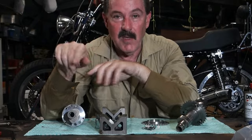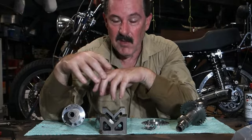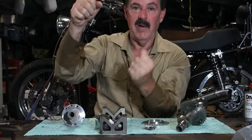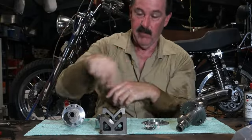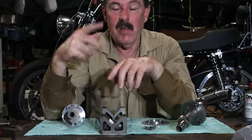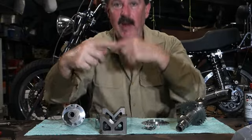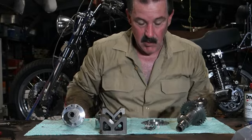And there are other times in its rotation where you're probably compressing 3 valve springs all at one time. So in other words, as you're turning the motor over, it's sometimes quite easy, and then you'll get to a very, very difficult part and you've got to go like that to get it past that part of its rotation. So the cam action in a rephased engine, rather than being constant and smooth, is quite jerky, right? So what does that have to do with anything?